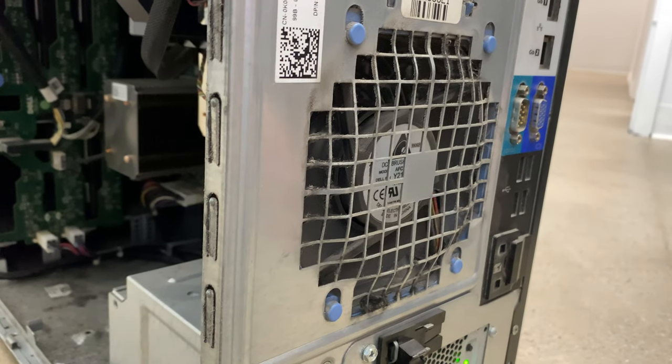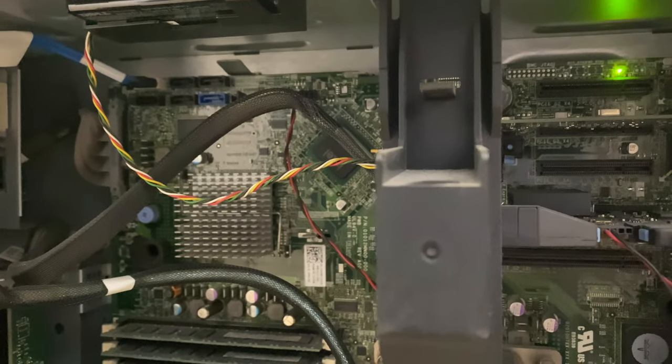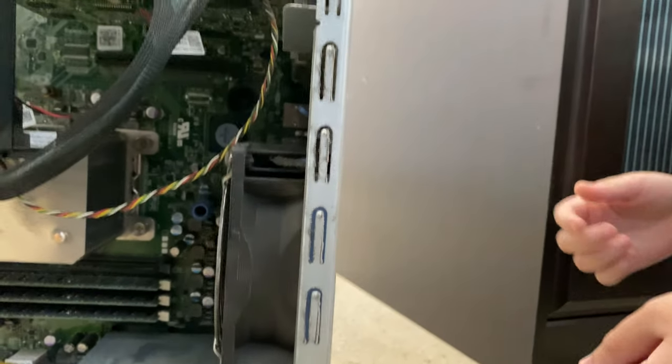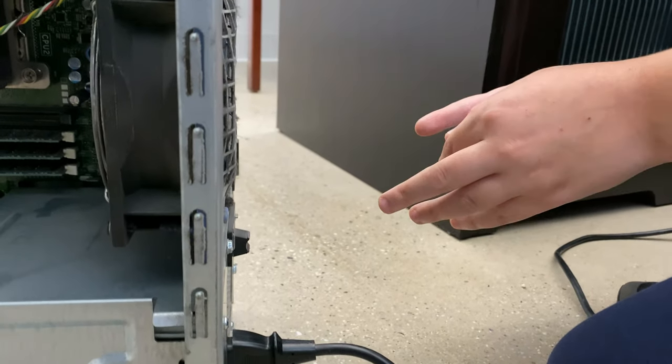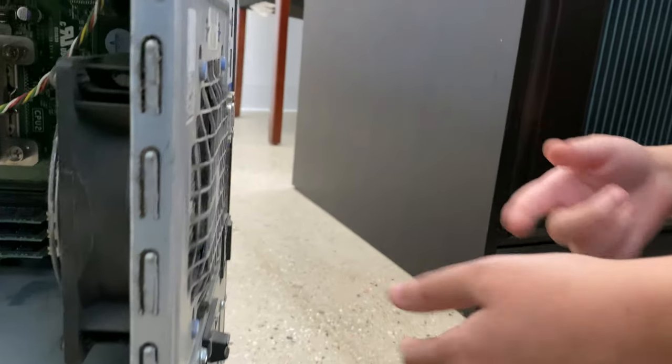It's not turning on right now — it's just starting up all the fans. The only way to really turn all these fans off is to unplug it. But I'm just showing you that if it's anything above 3 and it's not doing this, that's a power supply problem and you would need to replace the power supply. After about 30 seconds it seems to be going down by itself.